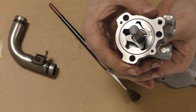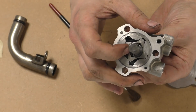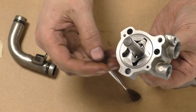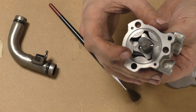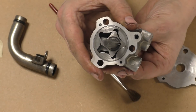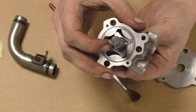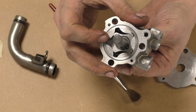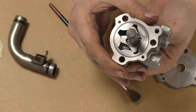If you have any debris in there it can lock up — there's just bits of crap. But that's how it works. You can see there are five recesses on the outer rotor housing, and then there are four lobes on the inner rotor that we're rotating. So basically they're always out of count — a four-to-five ratio rotation-wise. So as you rotate this you can see it locks in each one, but there's always this odd one where it passes between. There's a four-to-five resonance between these two.